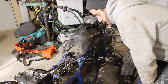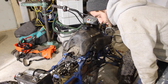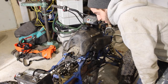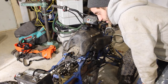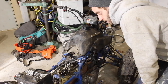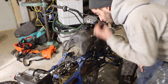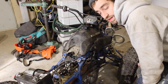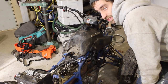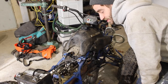Alright, so we got it to run off carb cleaner, which is great. That means we have compression now, and it means that the valves are functioning as they should. I'll probably go back in and just check the valve lash once I run it a little bit and heat it up. But we need to get the carburetor situated right now. And there was a problem with that because all the nuts in there were solid. They were solid. So I guess I'm going to have to put heat to it, which is a little dangerous